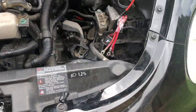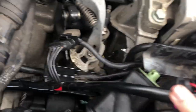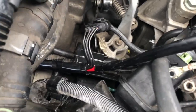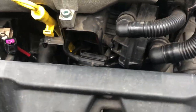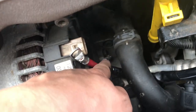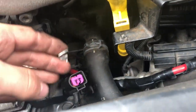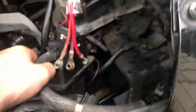I've almost gotten the new cable through — slipped it through and made sure the insulation didn't get caught on anything going under the hoses. I'll run this through the clip, get the clip that was originally here, screw it onto the side of the alternator, plug these two wires in, and then start putting everything back together.